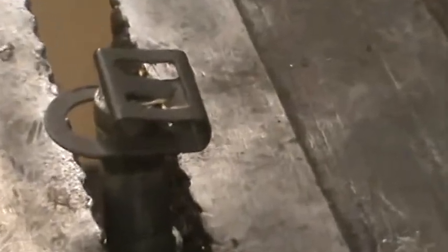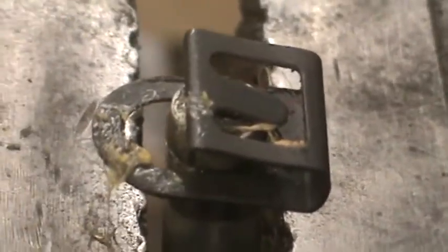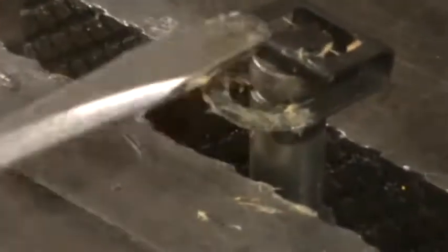Okay, I got that clip off in about 5 minutes, and I brought it over to the vise to kind of show you how it works. Basically, there's a bigger hole in the end of it right here that this pin will slip through, and then there's a groove in the pin all the way around. You can kind of see it there. And then it was pushed on farther than it is now because I couldn't push it on. I didn't want to push it on and have to go back and remove it again. But essentially what I did is I slipped a screwdriver underneath this lip here, which when it's on all the way, it comes down over the end of the pin. And that's what locks it on.